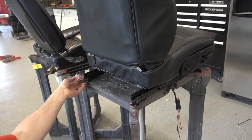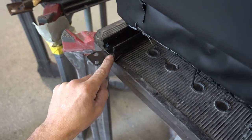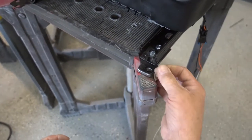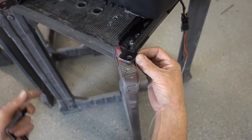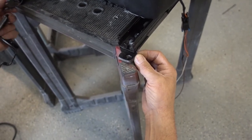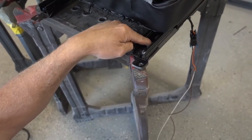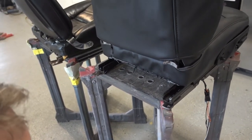For the rear, this normally had a drop and then it came out, and we literally just made it straight. On the door side, we actually had to build it up a quarter inch to have the seat level, so we brought it up a quarter inch. On the passenger side, we made it level, so now the seat will sit in there even. Again, the two bolts versus the rivets — we just drilled them out and made new brackets for that.